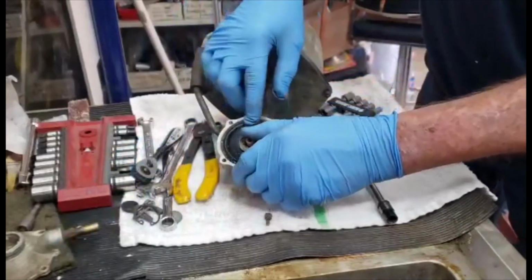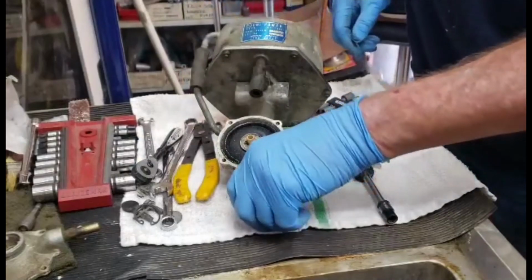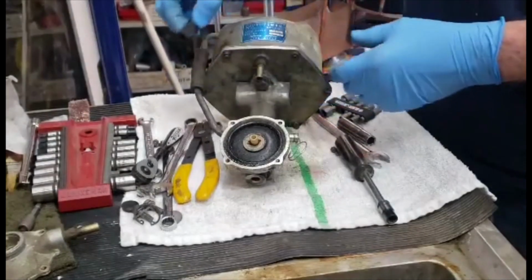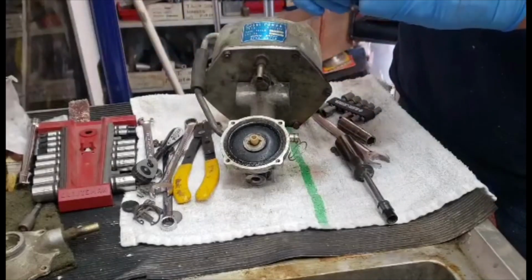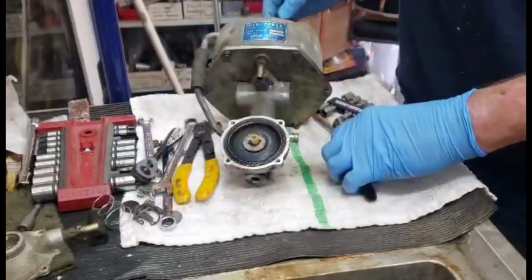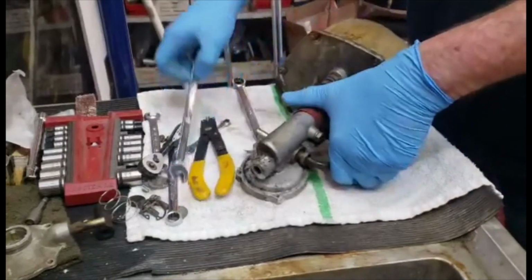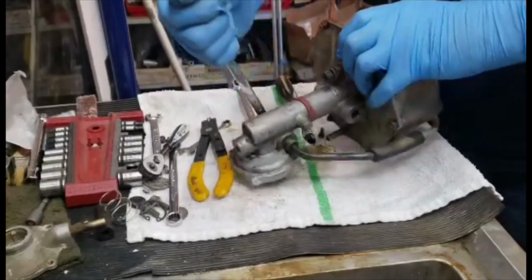And underneath here, there's not supposed to be any fluid in here either. There's a junction hose here. There's 2 of these. There's one smaller, one bigger. You can reuse these. They're vacuum tubes, or you can get new hose and put in there. And while it's still together, I like to take out the other fittings, because you get a little more leverage. Unless you gotta put it in a vise and do it, but